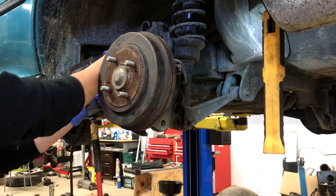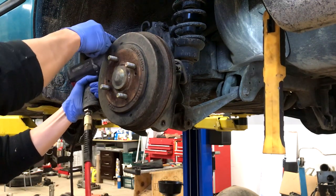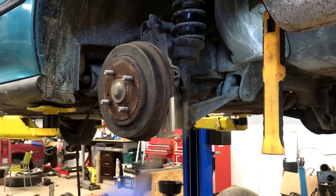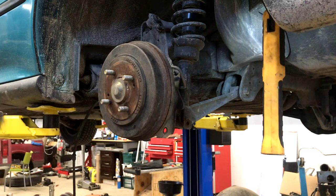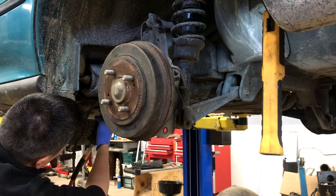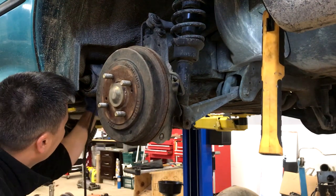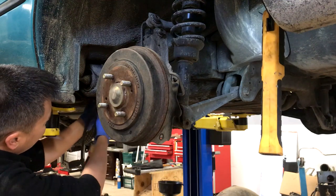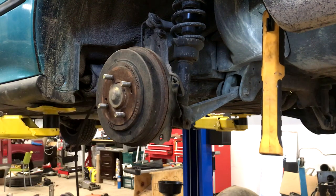There's a 14mm bolt up at the top — use your wrench to help pull that bolt out. So that's loose, and then we've got two 17mils on the front holding the trailing arm bushing. But before I do that, I'm going to do the toe adjustment bolt because I don't want that link staying on and getting twisted. You can see the mark where the toe adjustment bolt was previously — put it back close to that mark so you can get it aligned.